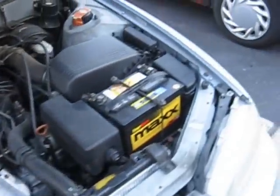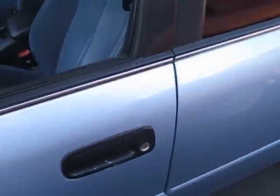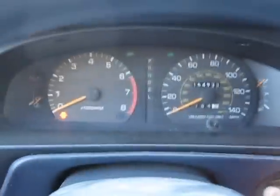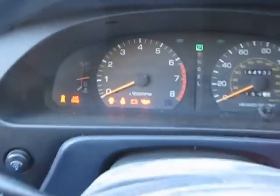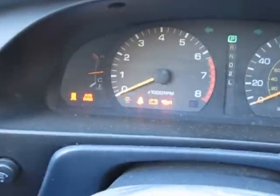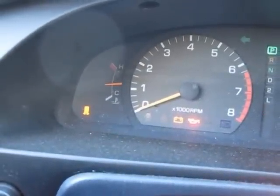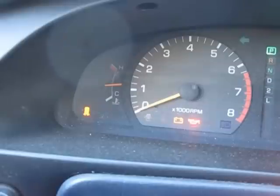Go back in and turn on your ignition. Don't fully crank the car — just go ahead and turn it over and take a look at what happens. Your check engine light starts to flash and then you can check for the number of times it blinks to find the code.